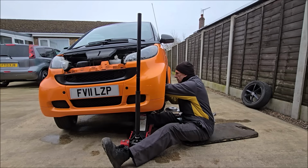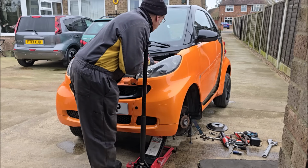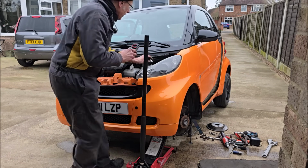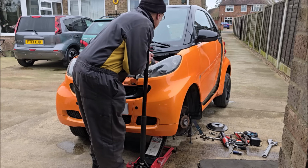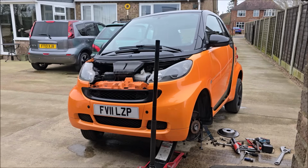Before we stick the spanner under there, we wrap a rag around the handle. Okay, so it doesn't touch the wing. So don't hit the wing, yeah. So now to find a socket that fits the top of the suspension. Why are you choosing a shallow socket? It'll give me more room to... Right, so it's 21 mil. Extension. Shallow socket, little extension, and then a bar.